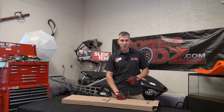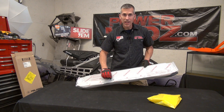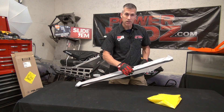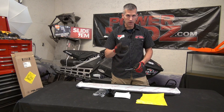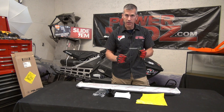Let's see what we get in the package. The windshield comes with a protective coating to keep it safe during shipping. It's got a nice little weather stripping underneath the bottom so that wind and debris don't come through underneath the windshield. All the parts come in this little baggie. Everything you need to install this windshield is here except for a T25 Torx driver — you're going to need one of those.